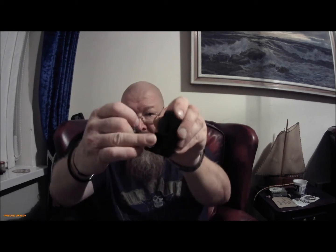Now, the way that the pumps are made, if it starts leaking, this bit shouldn't get water in. The top bit with the electrics in shouldn't get water in. But if it starts leaking, because you've got a shaft that goes through from the dry electric side into the wet pumpy side, you're going to get water through and it's going to seize up, it's going to rust up. If you catch it early on, you'll be able to spray anti-seize oil, penetrating oil, into this hole where the electrics come from, and if you're lucky, you'll be able to get it to move again. This had seized solid.